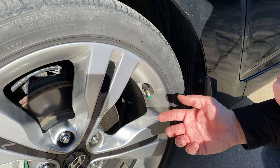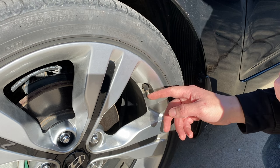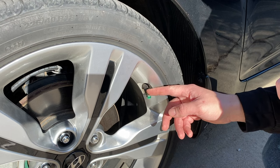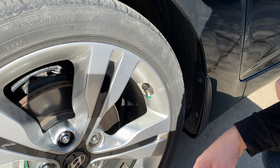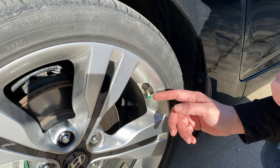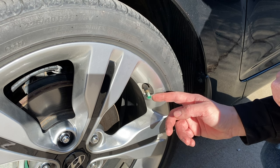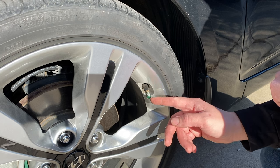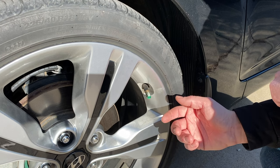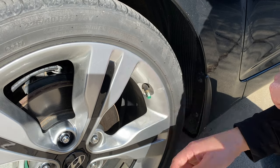There's really only one method that I've ever seen that works, and that's actually grinding the material away just before you get to the actual valve stem. So we've got our Dremel with the little cutting wheel on it. We're just going to be grinding it away and then we'll put a pair of vice grips on it and use pliers to back this out. So let's go ahead and get our Dremel set up and try to take away the material and get this off.